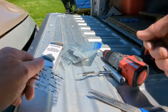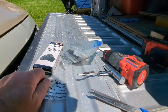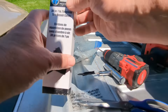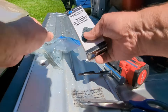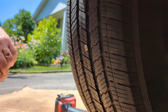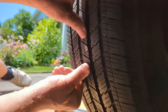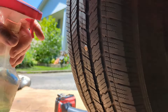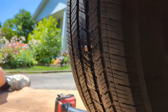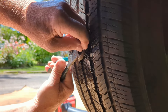The tool will come out and leave the plug in the hole — as easy as that. In the kits they always give you a reaming tool to ream out the hole after you've removed your nail or screw. Here's my reamer — it's about 3/16ths or so. The purpose of reaming the hole is to clean off any rust on the cords inside the tire. There's not going to be any rust on my belts because that screw only got in there yesterday — 24 hours, no rust. But even if there is, that drill bit will clean things up.